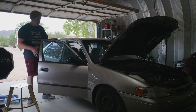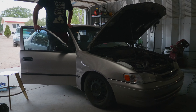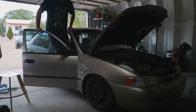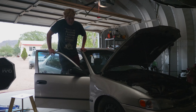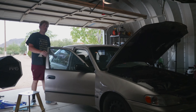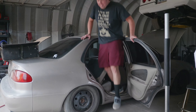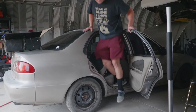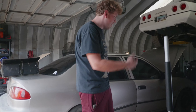So we got both fronts installed. Jumping on it, there's no weird noises. There's a lot of deflection in the tire — the tire deflects more than the springs. But the rear is a treat; there's nothing in the trunk. So I think it's an upgrade already.